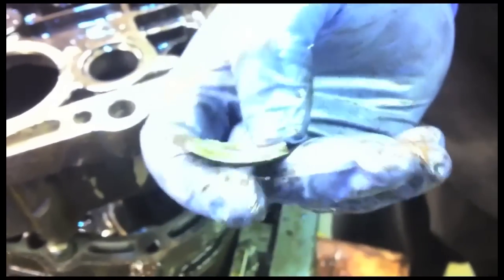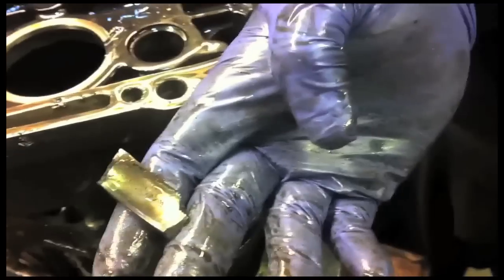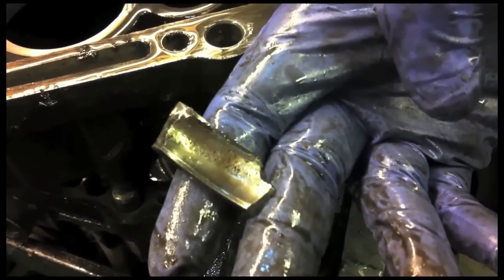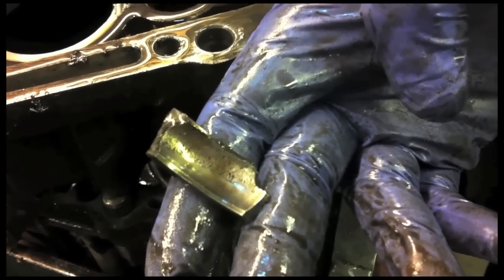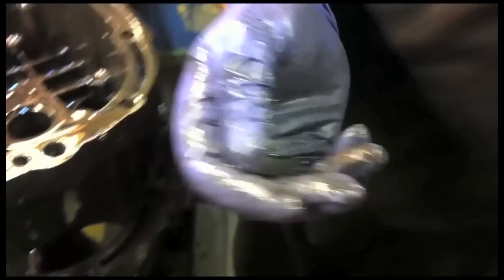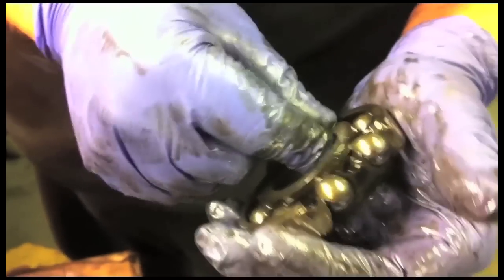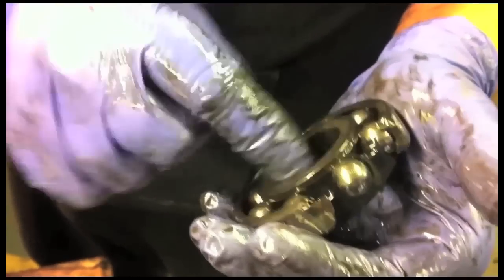It should have a rumbly bearing. Well, that was what it meant. See the wear surface. Oh yeah, that's very pitted, the loaded drive side of the bearing. And suddenly you can see that the balls are all damaged. Yeah, there's one of the main culprits of a rumbly gearbox.